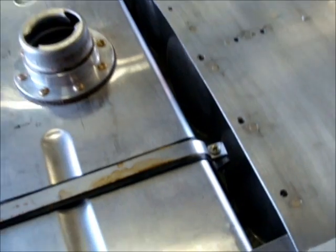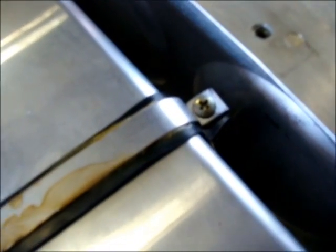One of the reasons you want to be really careful when disassembling your tank originally is you don't want to mess up these ends of the hold-down straps, because you've got to reuse those. Remember we spliced these together — so here's a splice, here's our extension splice out here, whereas the strap used to go all the way through. And then here are our new chafing strips.